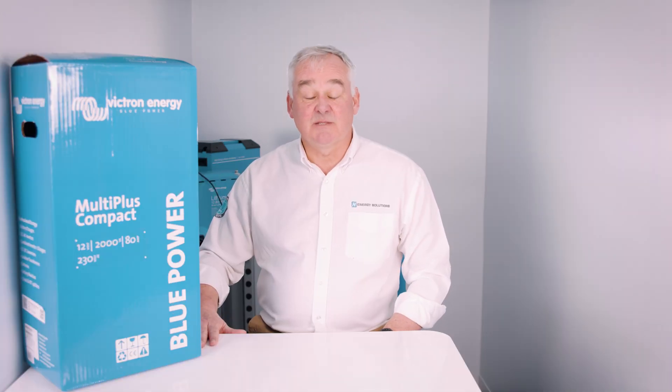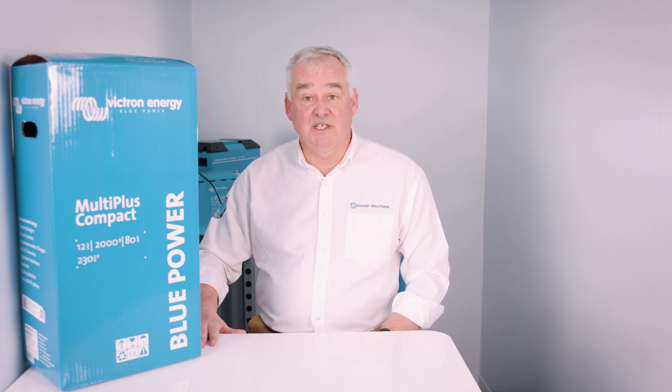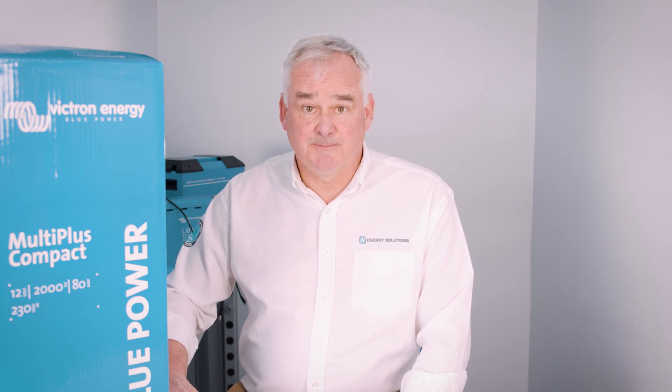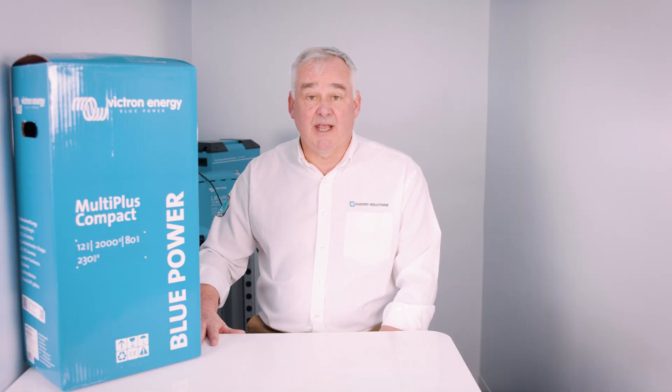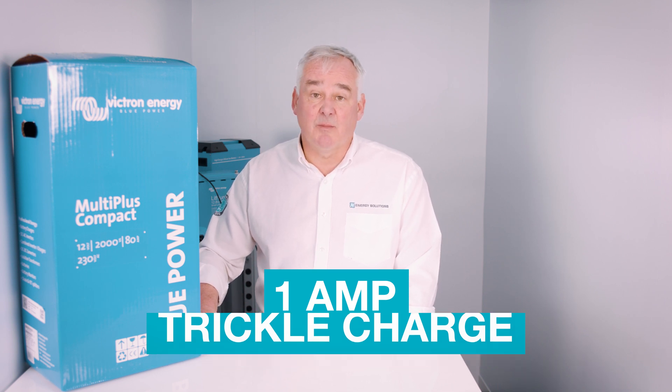The main output has a powerful 80 amp charging capacity for the house batteries, delivered via an adaptive charge. The software provides a three-stage automatic process fine-tuned for the conditions of the batteries, with a four-stage option there for long periods of float charging. The system also has a one-amp trickle charge system which is suitable for the start battery. It also contains a programmable relay.